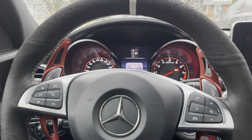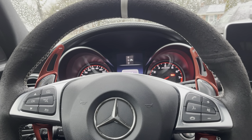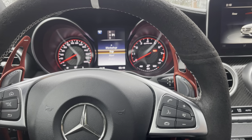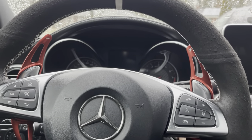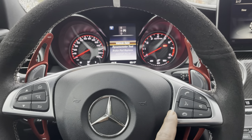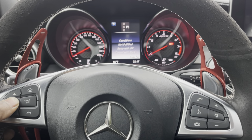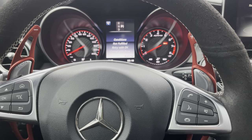Before you can change the back brakes you actually have to go into the workshop menu. To get to the workshop menu, hit the call button and the OK button at the same time and hold for a few seconds. Side note: this only works if you're on the trip screen displaying the miles. Make sure all the doors are closed and the ignition is on just one press. After you hold the call and OK buttons, it'll go to that page — scroll down to 'Brake Pad Replacement' and hit OK. Then you'll hear the brakes start winding themselves back in.